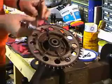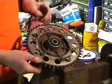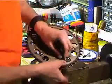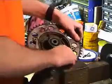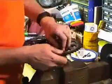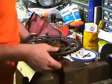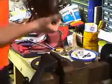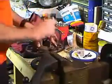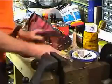So coming off the bottom is both the nut and the washer. So we're going to do that 6 times. Okay, so we've got all the nuts off. Now we're going to take the last of the bolts out. Kind of interesting. And then we're going to compare this sprocket to a new sprocket, because that's how you really know that you need to change it.